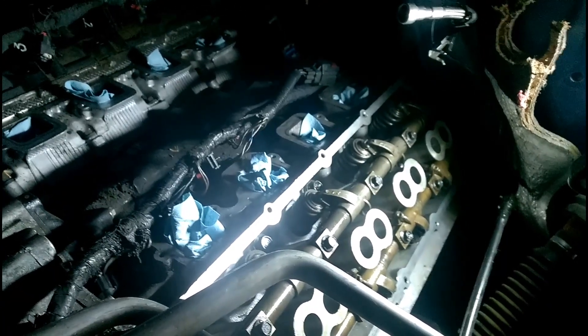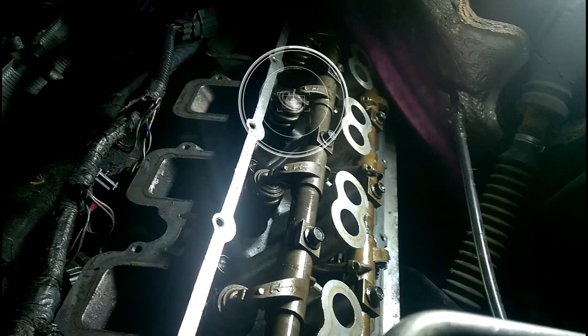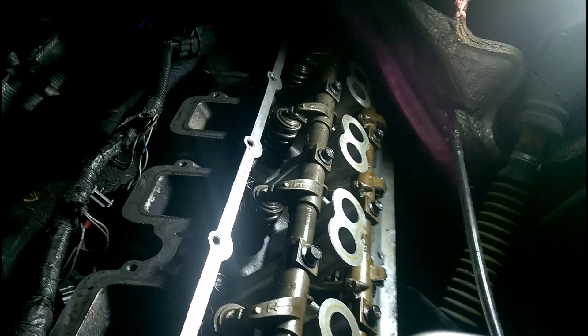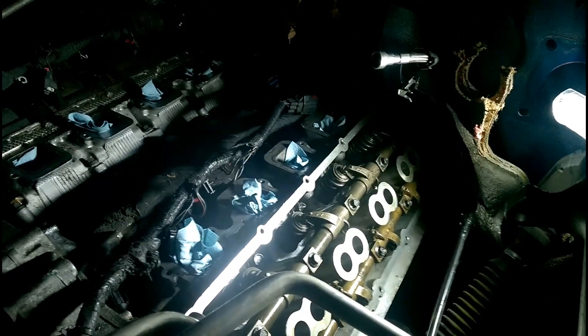All right, so we have a flat spot on the cam lobe for cylinder number 5. Spin it over. So if you watched just a minute ago, that lifter right there didn't do anything, and that's where we're having our misfire issue. The Hemi did not go as expected — it turns out there is a significant chunk of the cam lobe. I won't say missing; it's just rounded off, pretty much just a complete circle. Visual inspection early on couldn't tell that. Obviously it's a risk — anytime you have a lifter noise, there's always a chance of camshaft failure. Cannot appreciate victory without defeat.